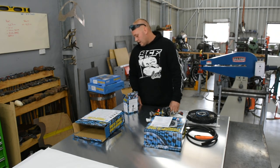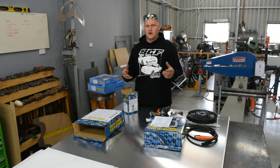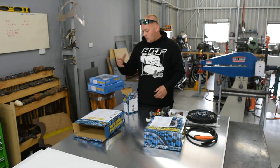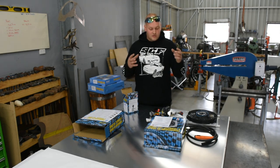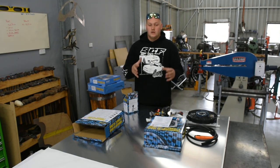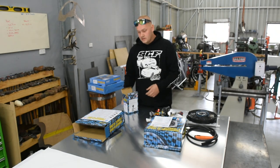On the engine cooling, by running an electric water pump, you don't have to run a thermostat in the car. Some people have dramas with thermostats — sticky thermostat, or not monitoring the right temperature range. By running an electronic system, you can do away with all that old technology and have it regulated through the computer. The electric water pump regulates the flow of the water as opposed to the mechanical pump setup where flow is only determined by engine revs and regulated by a thermostat.